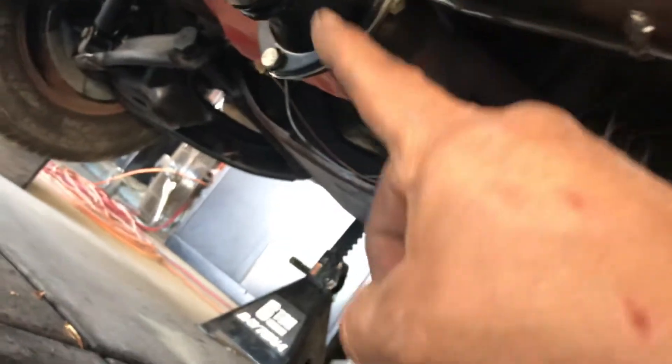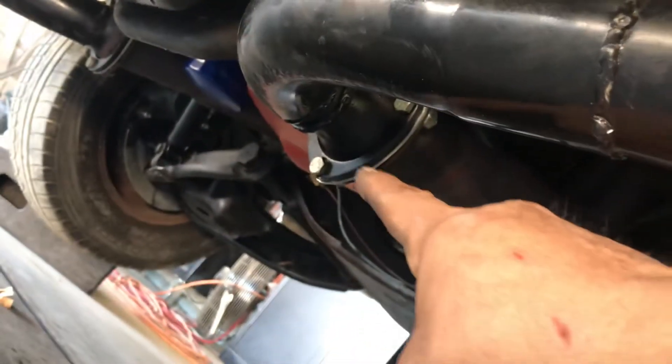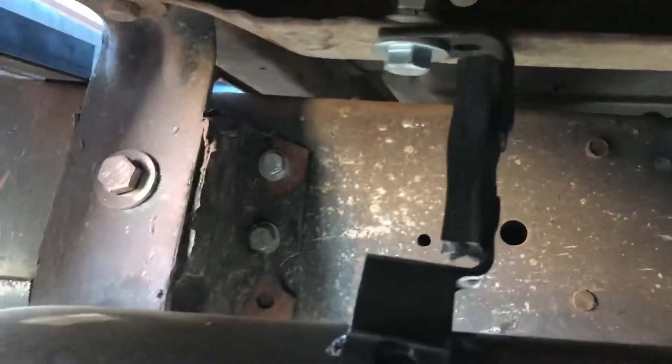So I went ahead and did that. All I had to do was get two 90s — let me show you guys. I got a 90 there. These are long tube headers also, so that's pretty good. The long 90 there, and then I brought it out the side and did another 90, and just put the exhaust back how it was but on the outside of the frame. I did attach it here. We'll see how that works out, but so far it's got plenty of clearance now.